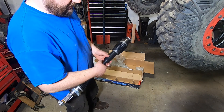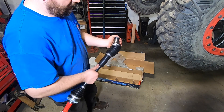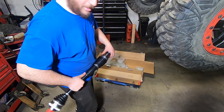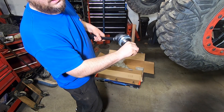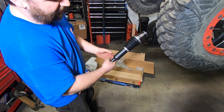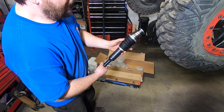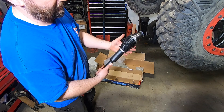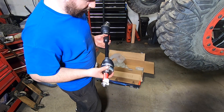While this idea is fantastic, a lot of people don't use it. Most of the buggy community is still running Porsche 930 CV joints modified for more articulation and travel. This idea is not new — it's been around for years, but they were very expensive. Now that they make these Chinese ones, I want to give it a shot and see if this could work in an off-road application. Track Motive advertises 45-degree operating angle on the CVs, which is just insane. They say this has almost two full inches of extension in the ball slip section. The boots seem very stiff — they prefer the stiffness because they're durable when rocks hit them, but I don't know if they're going to hold up.